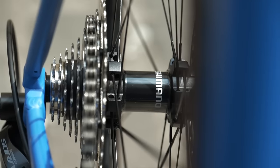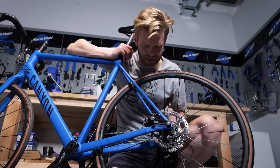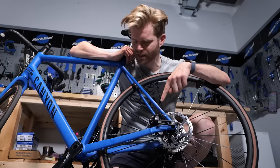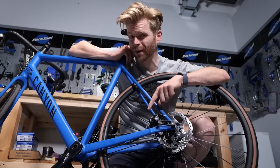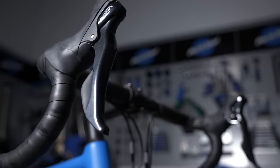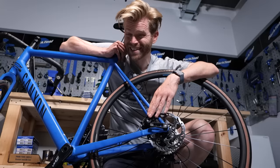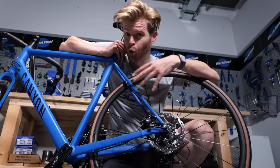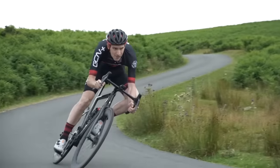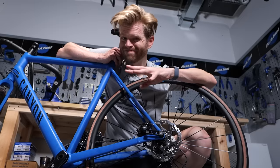At the back it's nine speed, whereas on the Di2 Dura-Ace it's now 12 speed. Another big thing is that the gears are mechanical — they're not electric. The braking is probably the biggest thing for me. We have disc brakes here on Sora, but they're mechanically actuated calipers. Shimano groupsets turn to hydraulic calipers in the tier above this, Tiagra, and then all the way through to the very top. There's a big difference in performance from a cable-actuated disc brake versus a hydraulic one. Hydraulic ones offer more stopping power, but also greater feel and modulation, so you've got so much more control when applying the brake. Upgrading your cables can make a bit of difference, but hydraulic and cable — night and day.